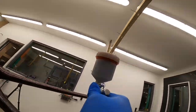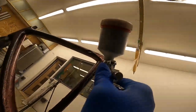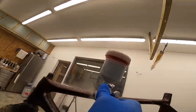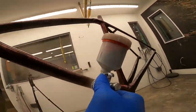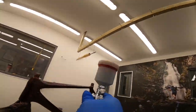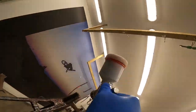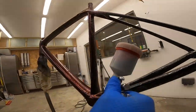But if you're just doing a standard candy finish, it can cause some issues for painters, because any slight imperfections are going to show up when the job's finished. So you have to make sure you give yourself the best chance that every single coat of paint you put on is just right. You don't want to pick up any bits of dust or any bits of muck or anything like that, because with the candy colours, they'll never disappear. They're always going to be there.